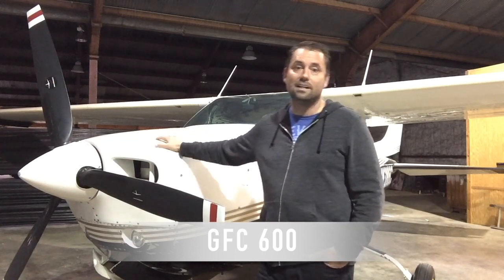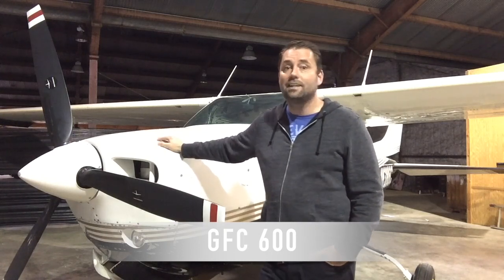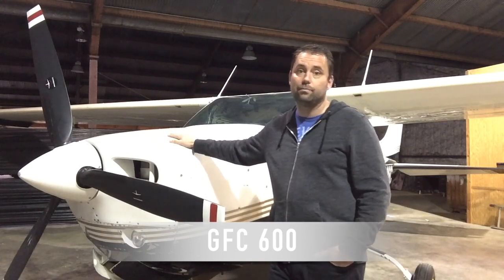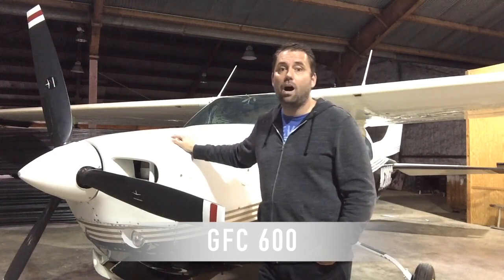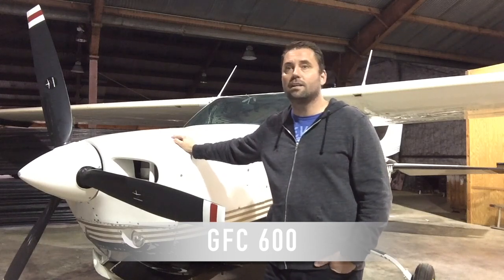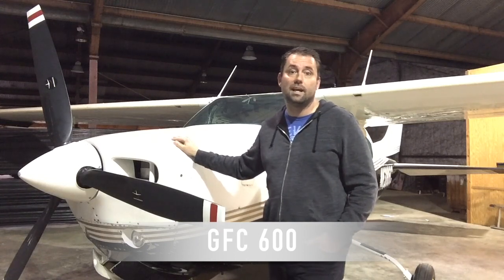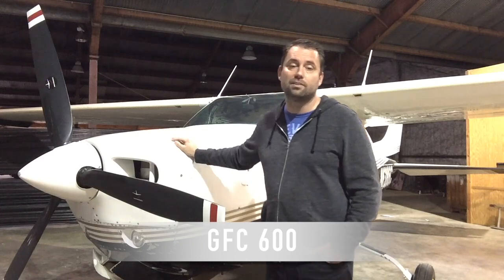A significant factor in that decision will likely be who has your aircraft on their certified list in the STC. For instance, this Cessna 210 November model is getting a Garmin G500 TXI PFD and we wanted a digital autopilot that could communicate on the digital data bus. STEC has the Cessna 210 certified for the 3100, so that was a significant factor in our conversation. The GFC 600 is really designed for advanced singles, twins, and turbine aircraft, as it adds the option for yaw damper making it a 3-axis autopilot. It will likely cost you somewhere between $26,000 and $35,000. The GFC 600 is currently certified for the Cessna 182 Papa through Tango models, the Beechcraft 36, A36, and A36 TC, as well as the Baron B55 and B55A, with more aircraft in the certification process.